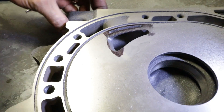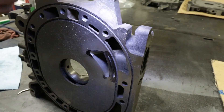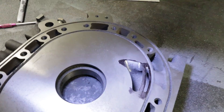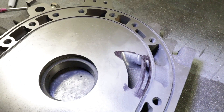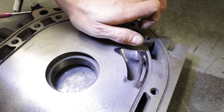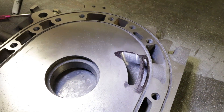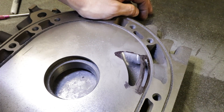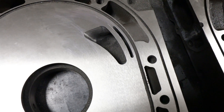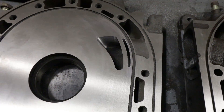As far as the angle of this area that you've ported — is that just based on experience or are there guidelines? Sort of. If you look back in there, there's actually a water jacket. If you just brought the intake port closing edge straight down the way they are from factory, you'd be right into your water jacket. So you actually have to curve it around that water jacket. And it's always nice to have a nice leading closing edge — not an abrupt stop where any of the seals going past are going to get caught. That is the main port — a pretty good start. The main shape is there; I think I'd be pretty happy with that shape. Just clean up the bevel on the closing edge — probably take some 120-grit sandpaper and give it a nice smooth edge for the seals to come across.